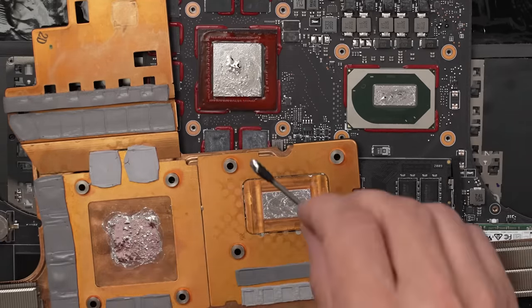Okay, you know what? A repair person needs to know when to stop, and this is where I stop messing with the display. I don't want to break it, so I'm going to reinstall it. I'm hoping that's enough to have caused the problem. I think it is, but I don't know for sure. The rest of the cable over here looks to be in good condition. So let's get this back installed and see if that one little cable's enough to fix it.